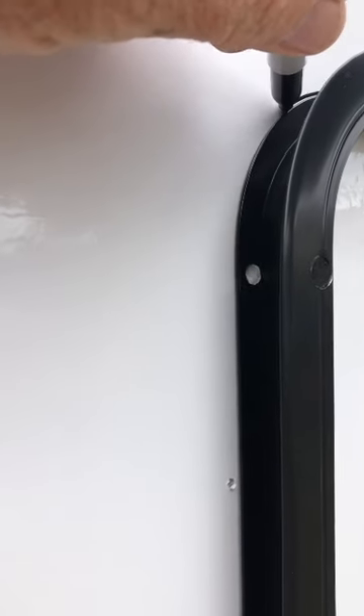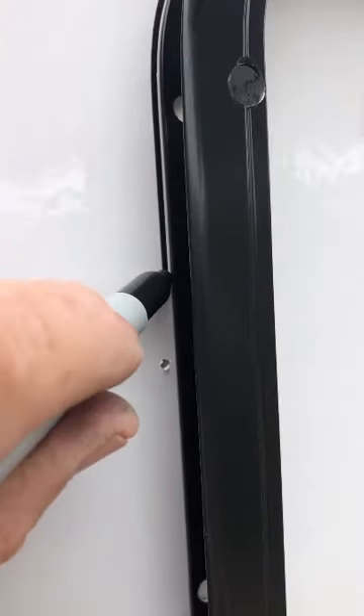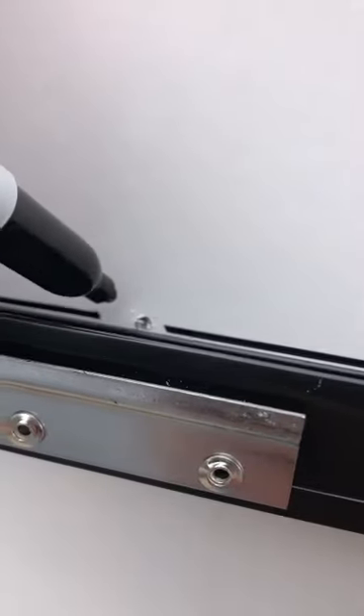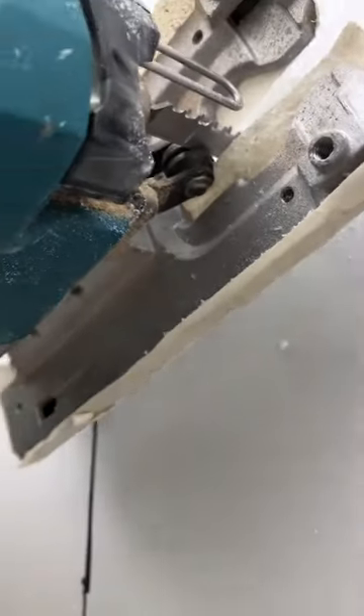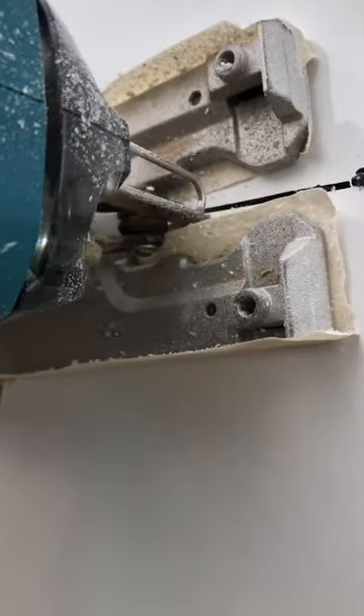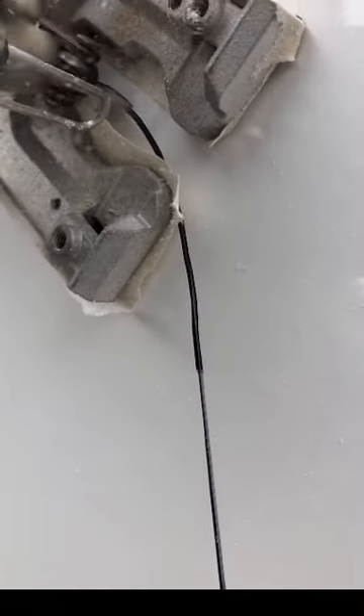There's been a lot of interest in these windows I put in the camper. They're made by Turnover Land and are a sandwich-type deal. I used the inner trim ring as a template, lined it up with some pilot holes I'd drilled through the wall. I'd framed some wood and pre-planned where the windows would be, so really all I had to do was cut through the foam and flax epoxy composite — no wood involved, just the foam sandwich construction.